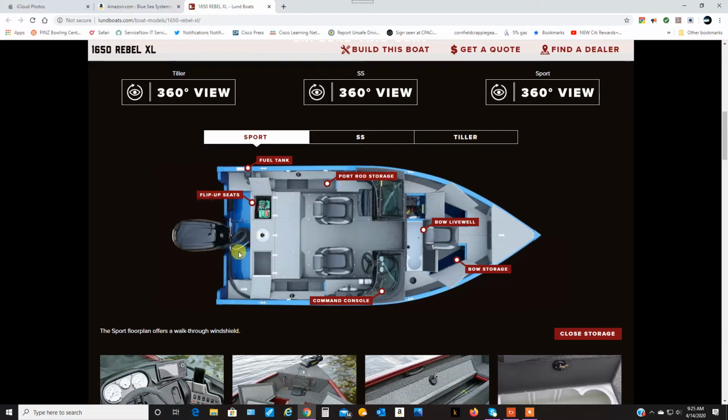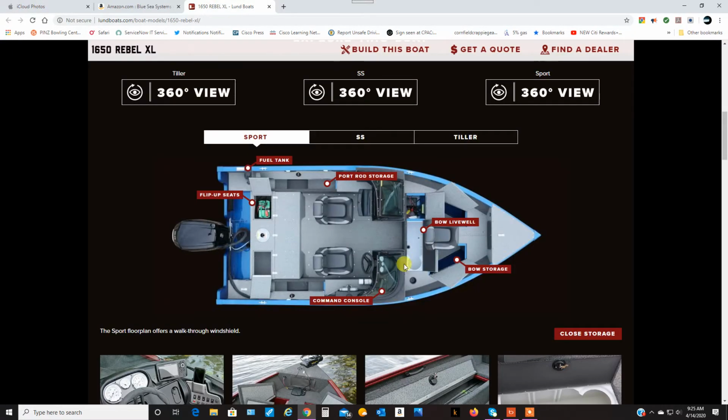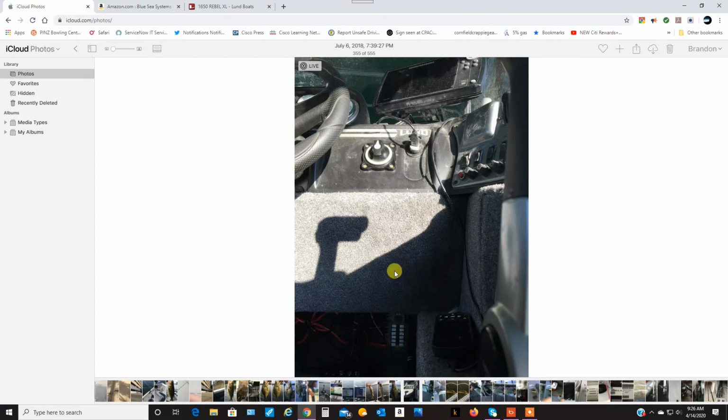Basically you go up this little boot, you unscrew that cap, pull the wire, and you go around the side to there. So you get both your positive and negative feeds run to the dash. Okay? Now, I've actually found on my boat it's easier to run it the other way. It's actually easier to fish it through this direction and tape it to like a fishing rod, poke it through, and then go that direction. But anyway, okay, so then we get to the console of the boat.